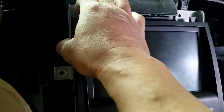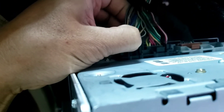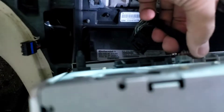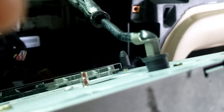I got all six screws out. I'm gonna pull it straight out - the whole thing will come out. Now what you got right there is an antenna adapter, and then all these plugs. This has got a Bose system. I'm gonna push in and pull out each connector. This one is for the camera, and the ceiling camera right here. There's a trick to that - I did show how to hook that up from an aftermarket to an overhead TV. Then take this antenna adapter out.